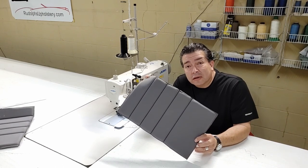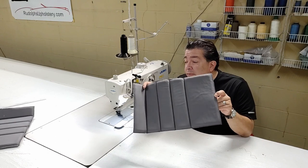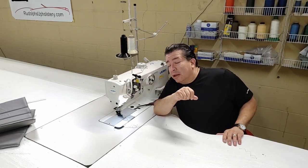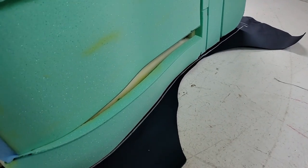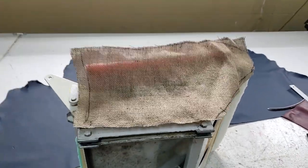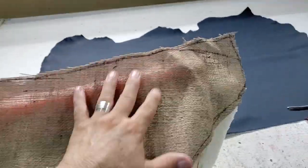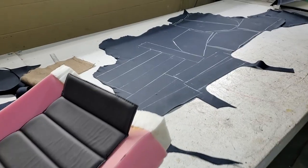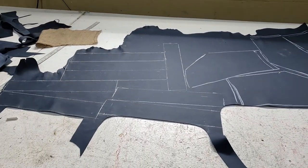Now I got all the patterns and all the borders sewn up and trimmed out — that was fast, huh? By the way, I'm doing four seats, not just two. All four are going to be identical. Making this side panel pattern was pretty easy — I just laid up the seat and drew a chalk line all the way around it. Here's another way of making a cheap pattern, because you don't want to use material that's too expensive: I got some really cheap burlap, laid it over, made my pattern, made it fit everything. That's a cheap pattern maker. When patterning out on the leather, you always want to maximize your yield and end up with the least amount of waste possible.